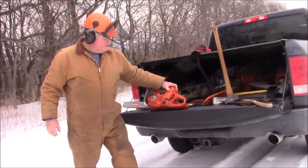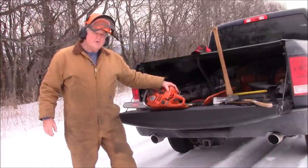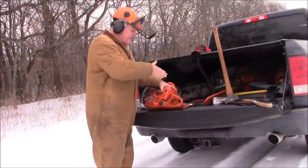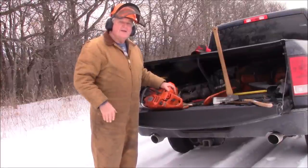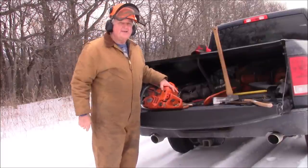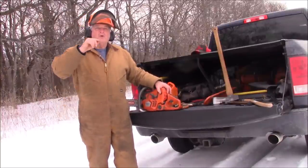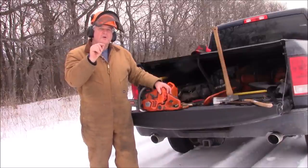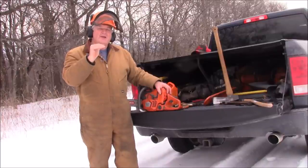And that's why Autotune will tune around other issues. So it's testing. Let's say a leaf comes in and slaps onto that air filter, it does the lean out test because now the air has been cut off, and as soon as it leans out, it starts picking up RPMs because it needs less fuel because of that choked off air filter. Well, the carburetor will start adjusting by holding the valve closed longer while it's doing its little flutter routine, letting fuel through in order to lean the mixture out and then does another test.